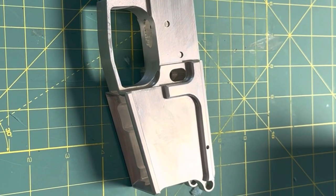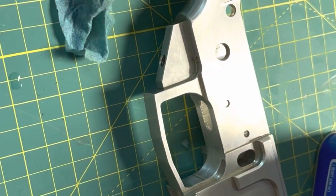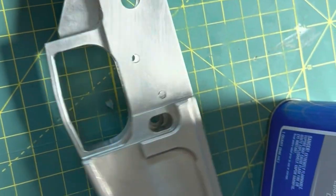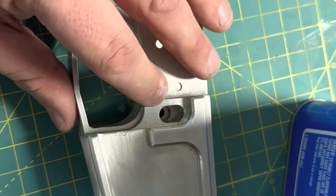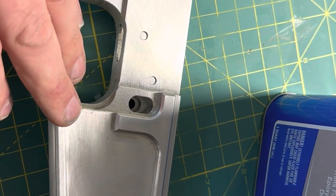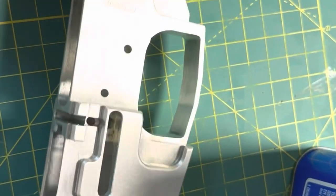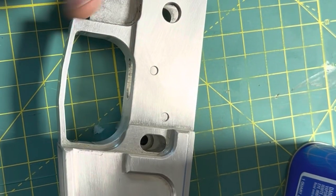Well, at least it cleans up easily. Just with some acetone and a shop rag, I was able to wipe all of my hard work off and we can start again. We will probably re-scuff just to be safe. Scuffing is basically roughing up the surface, and I'm afraid of some of those micro pores being filled with paint residue. So we'll re-scuff it, rebase coat it, and then start again.